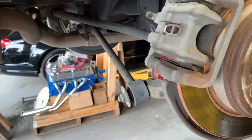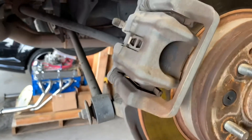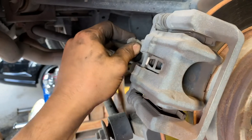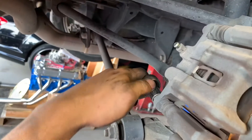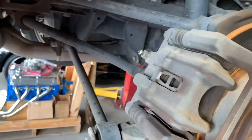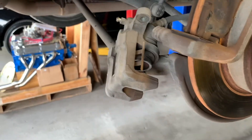For this job we're just going to be doing the brake pads — a simple swap. Should do the rotor soon though. First thing I do is go ahead and break the bleed valve here to make it a little easier on ourselves. With the number 10 we'll break that, and then with the number 12 we'll remove these two bolts holding the brake caliper in place.